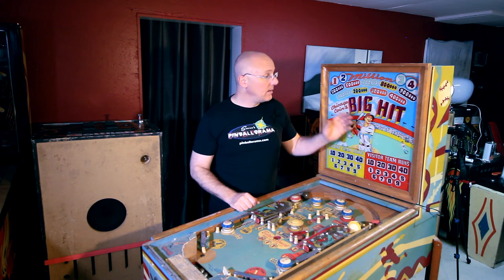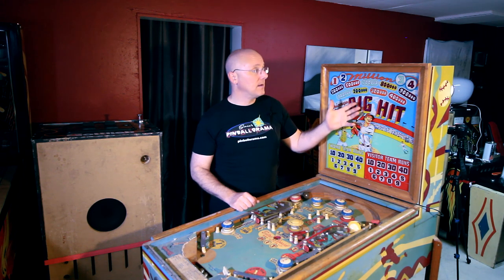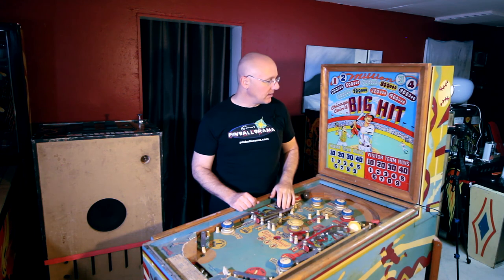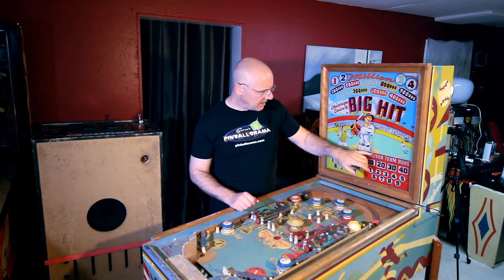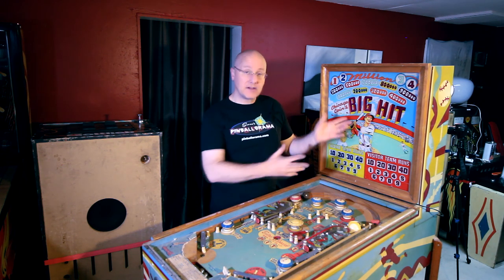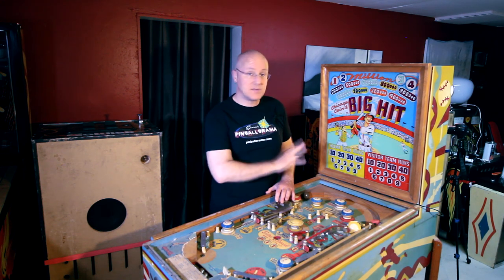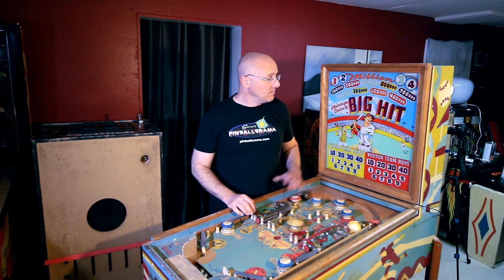The other thing I noticed when I opened up the back box was a little bit of flaking on the back glass, just a little touch here and there. So I wanted to pull the glass out and coat it with Krylon Triple Thick, which I've made a video on in the past. You can go check it out. It's my go-to thing now. I love Krylon Triple Thick for saving these old back glasses.